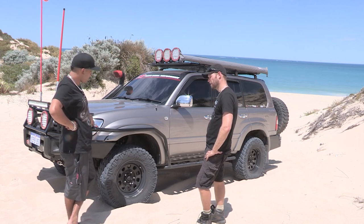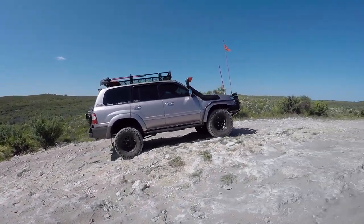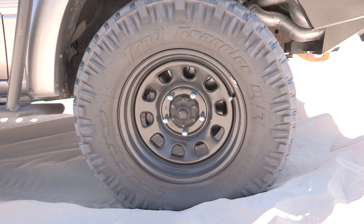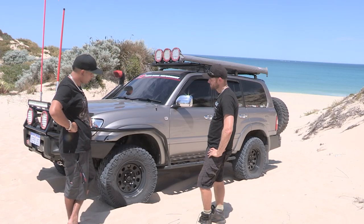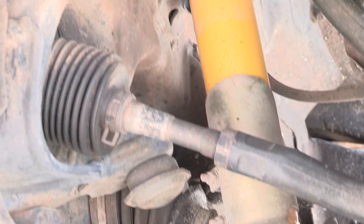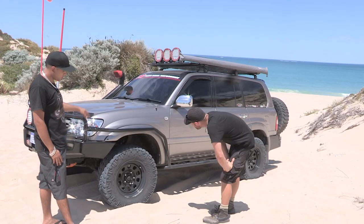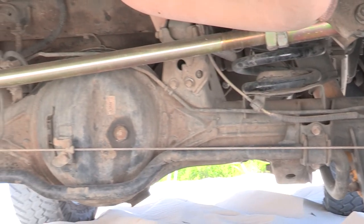Because mine are just starting to get noisy and they've done 55,000. The noise so far is still really well — even with towing a van, I found them to be a lot quieter than most of the other muddies on the market. Definitely doesn't hum too bad — last thing you want on them long trips. Your rims — have you changed your offset? Yep, zero offset wheels front and rear. Brought them out a bit more because I put the flares on and went to steel wheels because the alloy ones were getting scraped and bashed up pretty well. Your lift? Running an Old Man Emu 2-inch lift — the Old Man Emu torsion bars, rear springs, shocks, and I've got Total Chaos upper control arms at the front, 25mm road-safe diff drop kit just to bring the CV angles back down, and adjustable rear panhard rod.